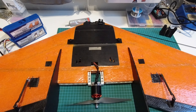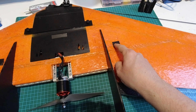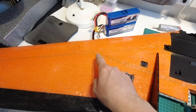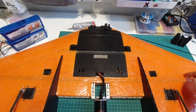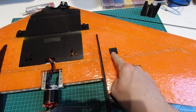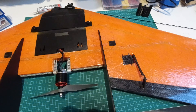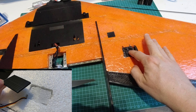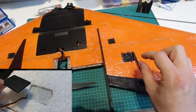With the wing painted, I installed the electronics: servos, GPS, receiver on one wing, video transmitter and antenna on the other wing, all the wiring into the electronics compartments, and gluing on the little Corex hatches — on top of the GPS, the blanking plate, and on the underside for the servos since that hole goes straight through. Between the servo and the bottom piece of Corex I fit a little bit of foam just to fill the gap.